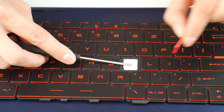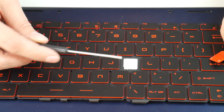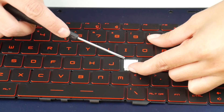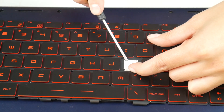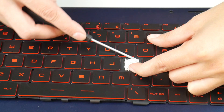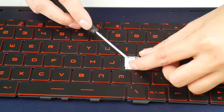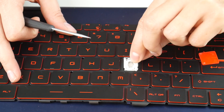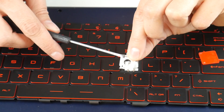Be careful not to bend the key cap — we initially did, which caused a small crack, so be careful not to bend it too much. Push up on the retainer clip while prying the top off of the two little metal hooks. Pushing up should free it up a little bit so it comes up easier. Once you get the top off, the bottom comes right off.